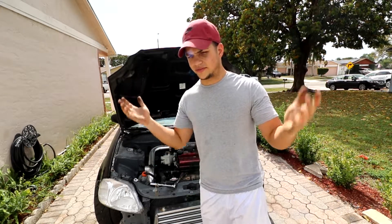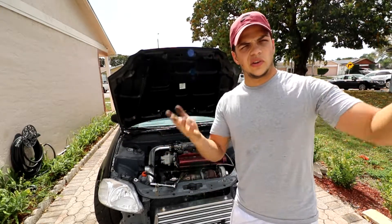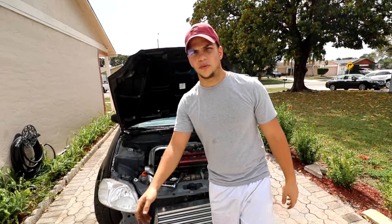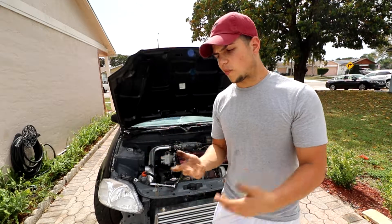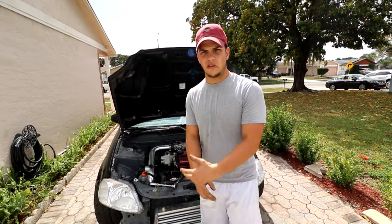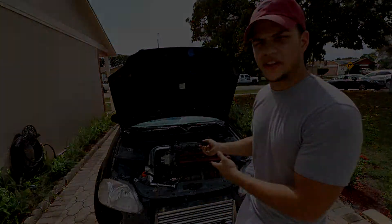When I say this motor revs to 8k, I did Super Tech dual valve springs in the head, which allowed me to rev to eight grand — and that's been fine for five months with no problems. This motor gets serious abuse: crazy track times and overall punishment, the worst of the worst. I'm honestly very surprised a rod has not come through the side of the block. To confirm the cracked ring land, we're going to do a compression test — the damaged cylinder will be lower on compression than the rest.